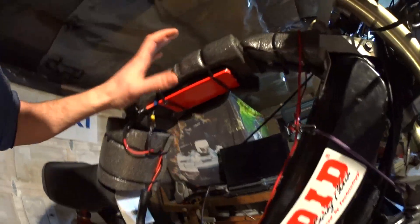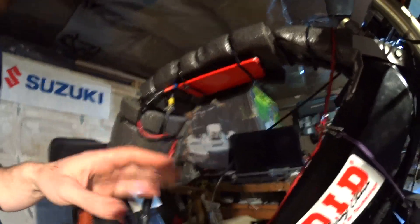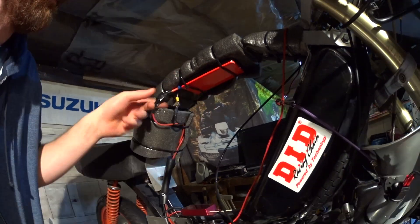My battery died. I tried this jump starter — a six amp hour lithium battery — which seems to be in bad shape after having the pump run for an hour, which draws one amp. It was down to 11.3 volts. In the last dyno session I had some misfires at high RPM, and that's probably because the main voltage had dropped to a little bit above 11 volts. I think a solution is to run a higher battery voltage, just to get some headroom.